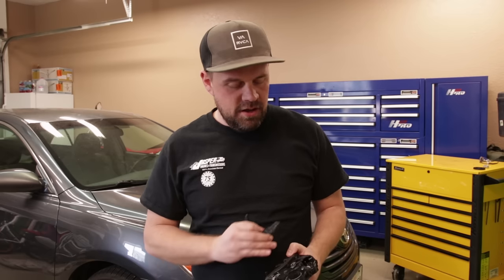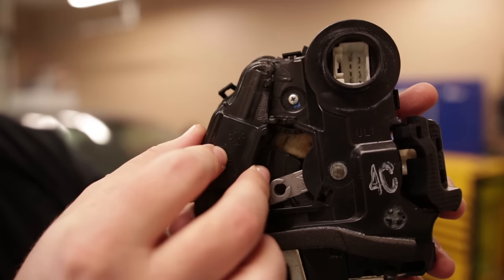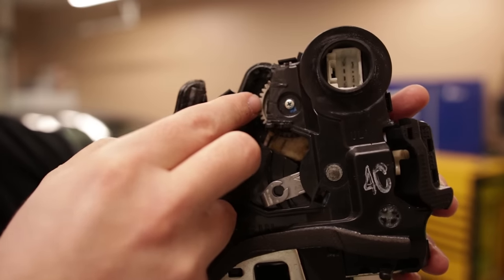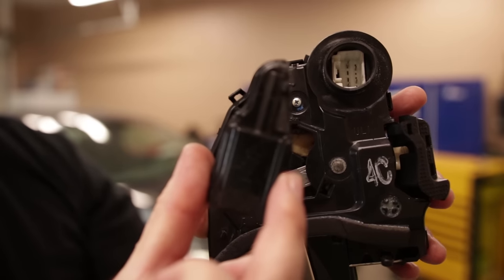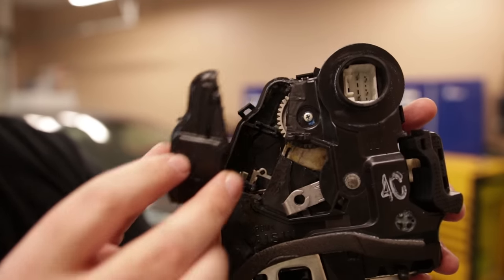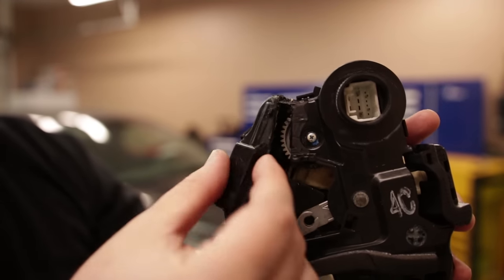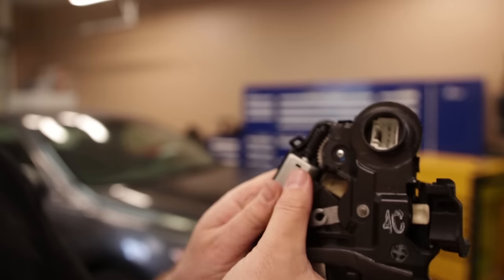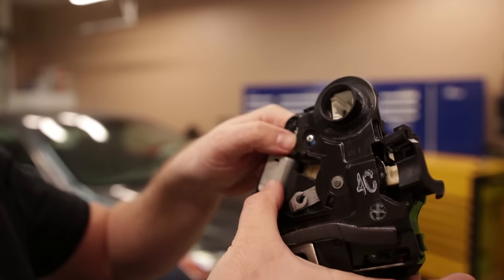I have to apologize — my camera turned off autofocus, so the focus is horrible on the part where I was cutting out the door lock actuators. What I've done is carefully cut this little cover right off the top. You've got to be really careful — I had to cut across this line here but didn't want to go too far and damage this gear. So I made a straight cut here, another one here, and another one here so that I could pull this portion of the cover off. Then we'll take some plastic weld and put the cover back on once we've installed the new motor, and plastic weld all the joints back together so it holds nice and strong. Take the motor — you can see how it has those two metal contacts — put the plastic gear on. This is the new one. Just take the motor and carefully install it right back into the slot and it pushes and locks into place. You can see this gear just moves this thing back and forth.